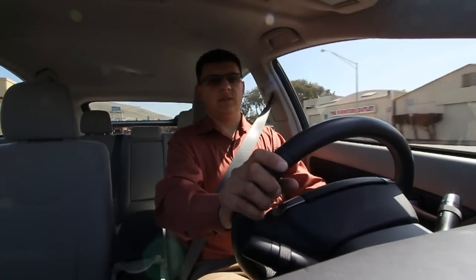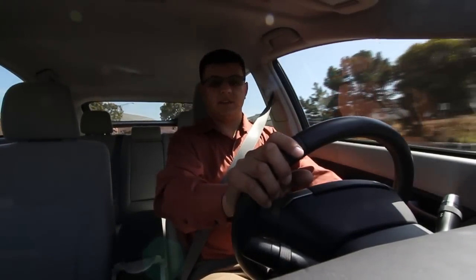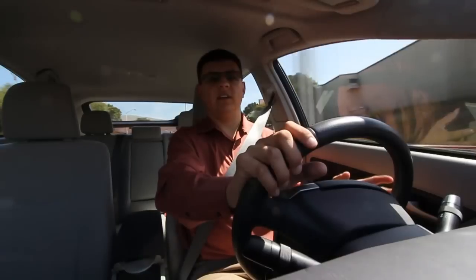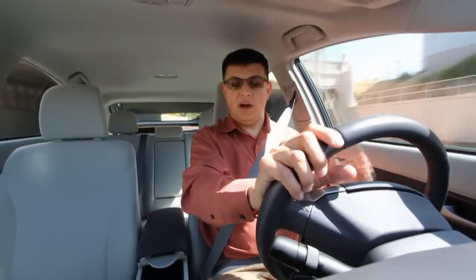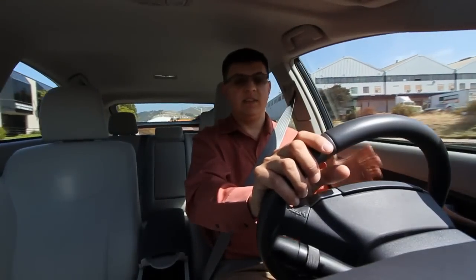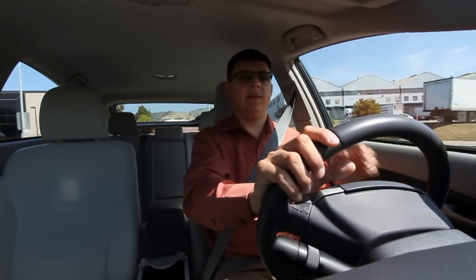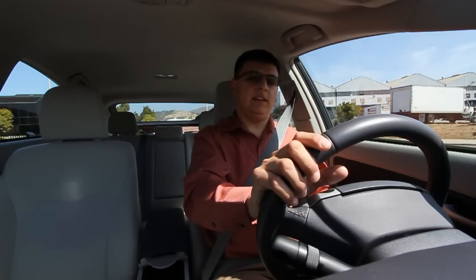The big thing we've noticed is that I live at about 1,300 feet and have to go over a 2,200-foot mountain pass to get to work. It's about 23 miles from my home to the bottom of the hill, and in that 23 miles I tend to average about 99 miles per gallon because the vehicle stays in EV mode that entire time, even though it's used the engine now and then to help up over the hill. At about 30 miles from home I've averaged 96 MPG; at 40 miles, 93 MPG; at 50 miles, about 85 MPG; and by the time I reach the office, I'm around 83.4 miles per gallon. So even though my daily commute isn't 13 miles, the plug-in hybrid has a definite impact on fuel economy.